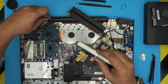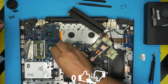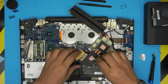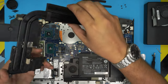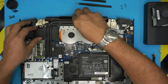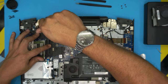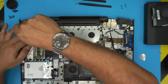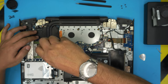on here. So I'm going to run the cable for here. Put one drop on the GPU and one tiny line on the CPU. And after that, do a quick pass. Okay, and quickly bring it over, set it down straight. Follow the numbers, screwing them or just cross screw them. I like to do 1 and 4 first, so that way the spreading of the thermal paste is better.